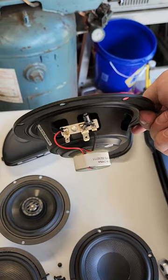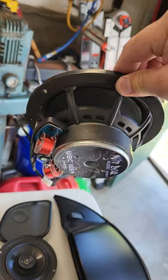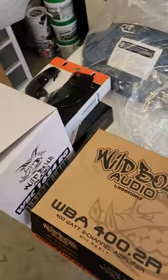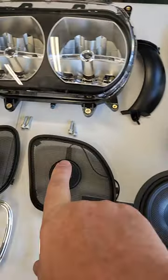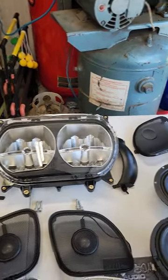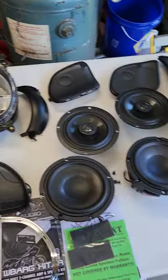So if I show you this — a little bitty magnet on there, a four and a half inch speaker — versus a six and a half inch speaker with crossovers and a magnet that would stick me to my Cadillac. That thing is pounds. That is substantial — should have some serious output. Pro tip: keep all your stuff organized. As you lay it on the table, put all the screws with wherever they go. Take your old takeoffs and lay them out in the order you took them off. Another great pro tip: take a piece of cardboard, draw a picture of what you're working on, and stick the bolts through little holes in the areas they are. Really important when you've got an engine or similar — lots of different lengths of screws that are very similar and you've got to have them all in the right spot. It helps you keep track of everything and keep your frustrations down.